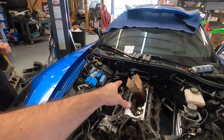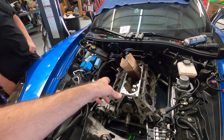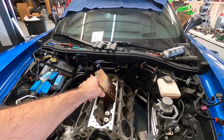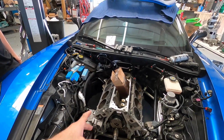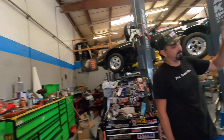All right, so dude, tell us real quick here. You got the cam in. We've got a custom spec cam. It idles mean as can be. However, it's going to drive absolutely fantastic. Now, this engine comes with 8 DOD lifters. So that means that it will shut down 4 cylinders. So this one, those 2, and then that one right there where you have the bosses, those cylinders get shut down. By replacing these lifters, we're going with an LS7 lifter that'll allow that engine to rev farther with a lighter lifter. Definitely going to increase the top end right there once we get the push rod length all correct.